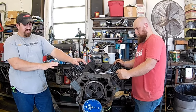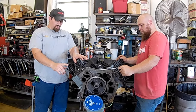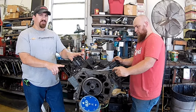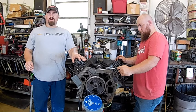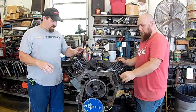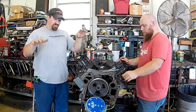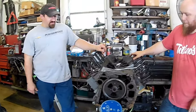The International project is moving along. I'm going to get this motor built, get it on the skid, and get to where I start connecting the transmission to it — but we probably won't do the drivetrain swap until this winter. Once the motor is prepared and sitting on the skid, we're going to back up and start working on the suspension: control arms on the front and the rear axle swap. That way when we go to transplant the motor, the suspension is already done and the truck will be lower to the ground.